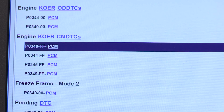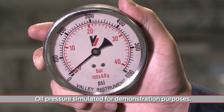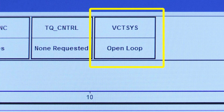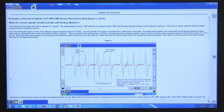Look carefully for any electrical DTCs, such as P0340 and P0345. These electrical circuit DTCs can be set by other issues within the VCT system, such as low oil pressure, oil bleed-off, restrictions in the lubrication circuit, and damaged VCT components. In these instances, the VCT system PID may show open loop, disabling the VCT system, making it difficult to diagnose the root cause. You may need an IDS oscilloscope to understand what the concerns are.